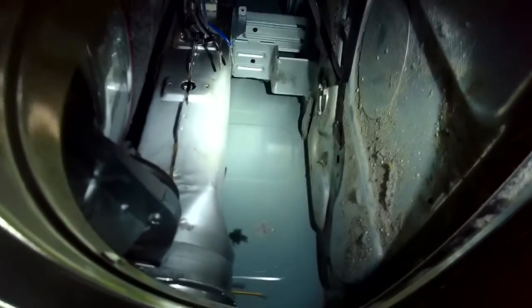And once you get your new one, all you got to do is just bring it in there and tighten it up. I'm also testing this other thing that's in the middle called the thermostat, and I should also get a beep from that one. That's very unlikely that that one would fail. And the one at the very back is the heating element itself, which should also give you a beep when you touch it with the probes. So the only one that didn't beep is this little guy, and that's the high limit. That's the one that's most likely to trip the fuse if it gets overheated.